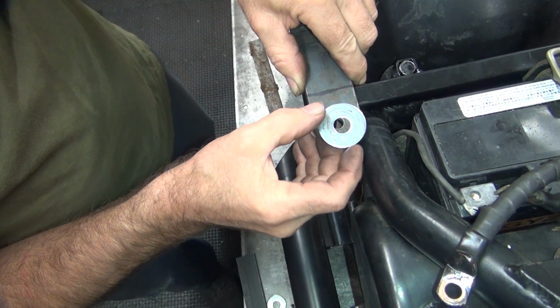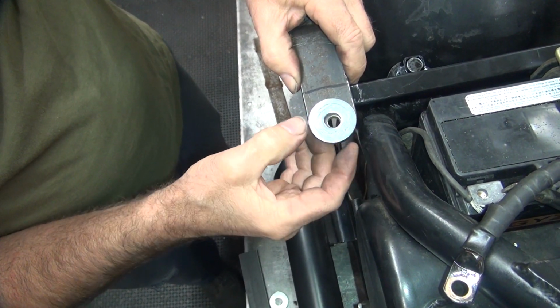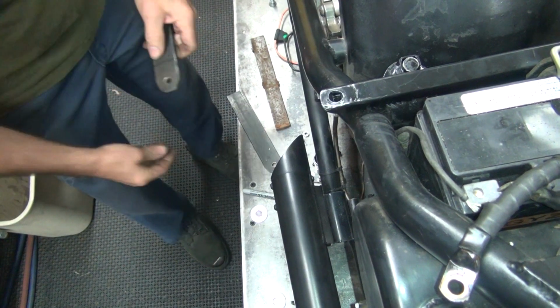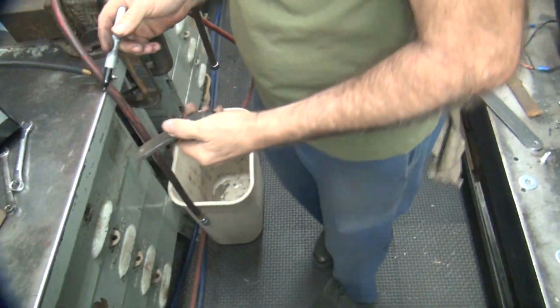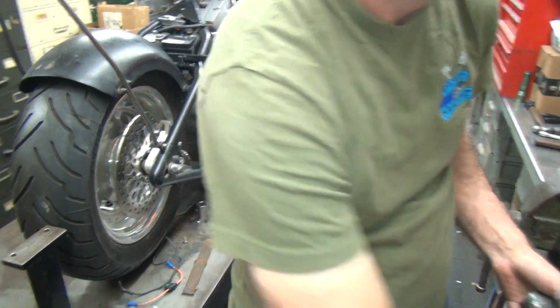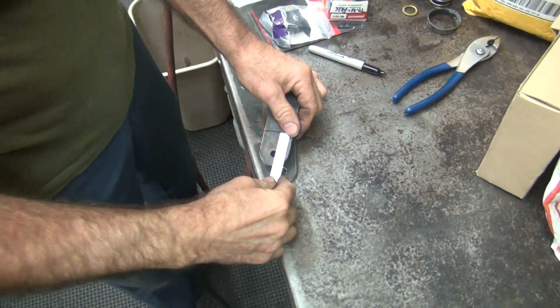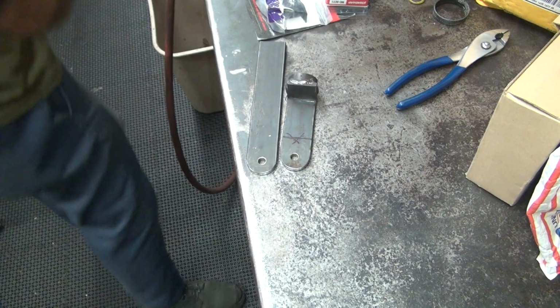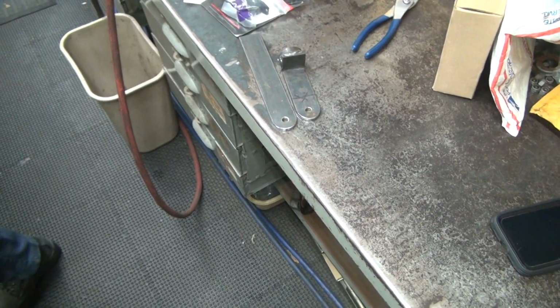We need the washer to be almost all the way. So we go with the longer of the two dimensions. So I'm going to go with that dimension there. Not this one, this one. The only problem is we're going to be seeing this one, not this one. So we want from the edge of the hole 1 inch. We can see that with the grinder really good. Put 1 inch on it, cut it. Perfect. I like even numbers, that's easy. And we'll do this side too? Go 1 inch. Okay.